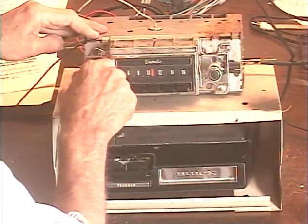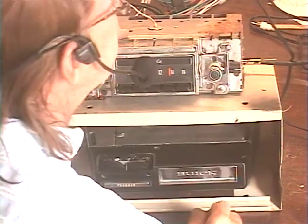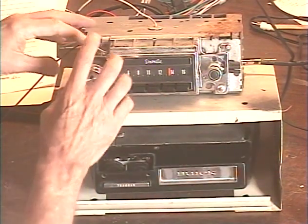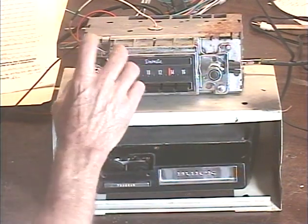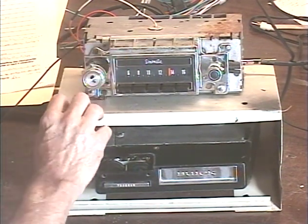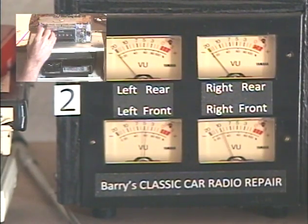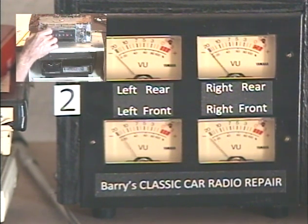Now we'll go back to FM so I can demonstrate the balance and fader functions. I'm going to activate the virtual front-rear fader — we do that by giving the tone control two turns to the right. I'm going to rotate it to center so I have room, then activate the virtual fader. Fader adjusts. Now let's bring the output level meters into the picture. As you can see, this tone control is now adjusting our front-rear speaker balance — all the way front, all the way rear. I'll center them, take my hand off the control. Fader set. Now you can turn your tone control back to how you like it to sound.